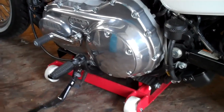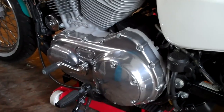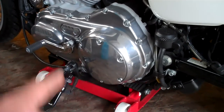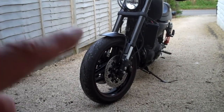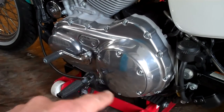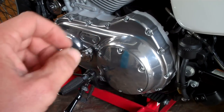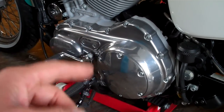Welcome back to the garage. We're going to do a clutch adjustment. Friend Holly has just done a service on her Sportster and did the clutch adjustment but wasn't quite sure about it. I did it the other day on my XR1200 but didn't film it. When we check the book we find that the clutch pack inside the primary case needs to be adjusted. You have to have some free play so that when the clutch expands it doesn't lock up and start to slip because there's no free play left.